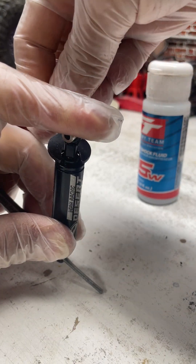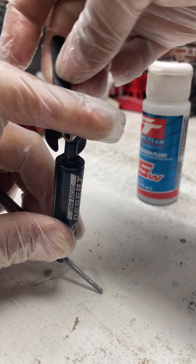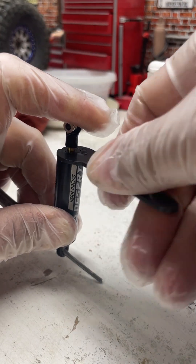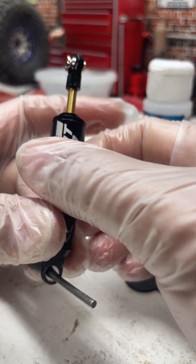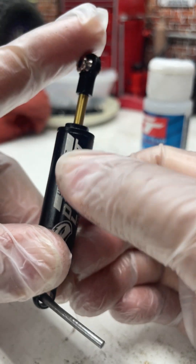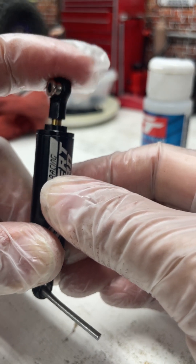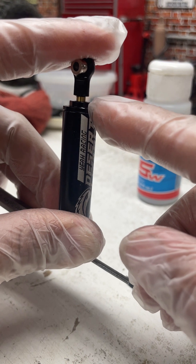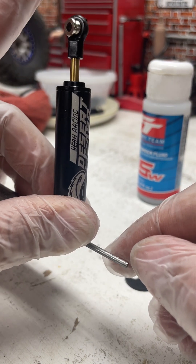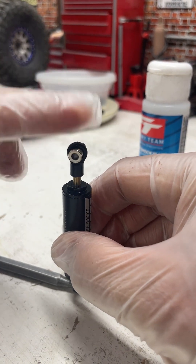These shocks come with an extra oil ring. I just changed the oil ring on this one while doing this process for you. You can see there's still very little gap in there, and the O-ring is actually what seals it. So if you have a good oil ring, it'll be sealed. Now, if you can see when I'm compressing it, my shock end comes very close to the bottom of the cap — so with a good oil ring, you can see there's a good rebound.